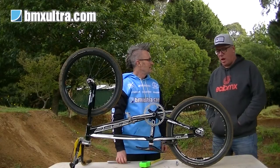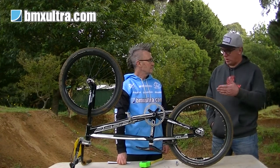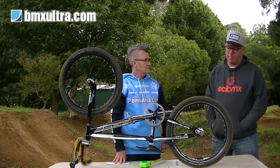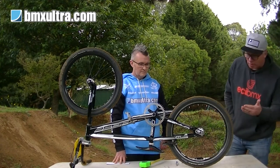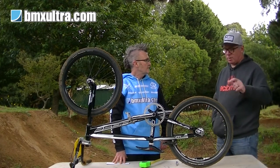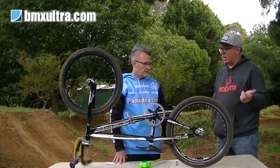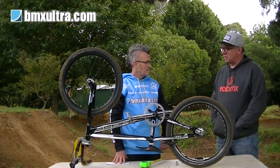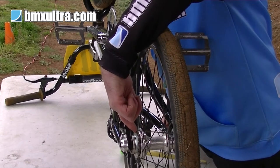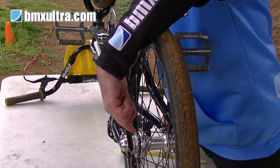One thing I've noticed is a lot of people don't realise you can actually change the spacing of your rear sprocket as well as the front, obviously. Yep, and you've got more flexibility on the hub. If it's Profile, you've got one big spacer in there and you can reverse the cog, and people feel they don't get enough movement. What else can you do? Can you buy narrower spacers and change things around that way? With the Profiles, because the cog is proprietary, you really only have two options there to align it.